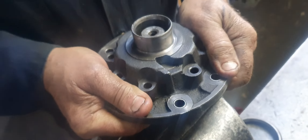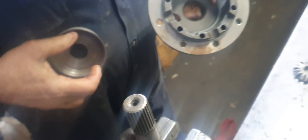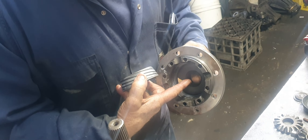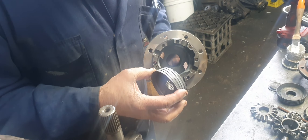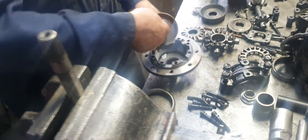See that? You can see the gap in there altering. When you rub it, see how it's bearing down on the end. So the taper — that one's too far around that way, and this one's too far around that way. It's touching down at the bottom. Wrong angle.